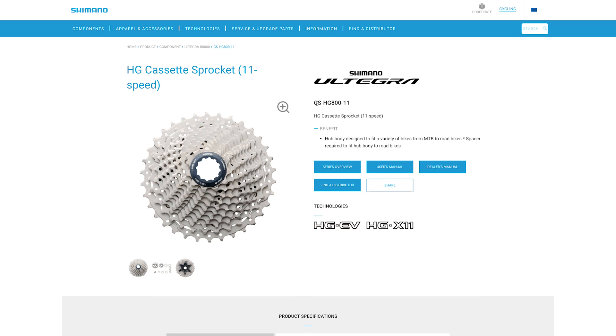First up, last week I tackled a question from Parik Furlong, who wanted to fit an 11-speed cassette onto a 10-speed freehub on his Shimano RS-80 wheels. I did give a couple of options, but Shimano have actually got back to me with another option: the CS-HG800 mountain bike cassette, which is an 11 to 34 ratio. By using a 34-tooth sprocket, you reduce the chance of any interference between the rear derailleur cage and the spokes.